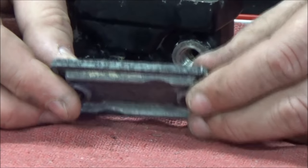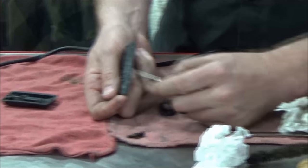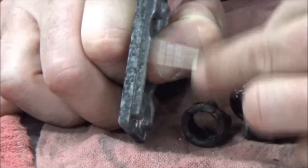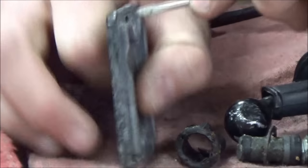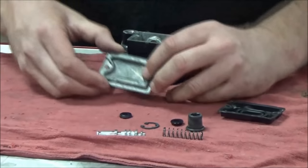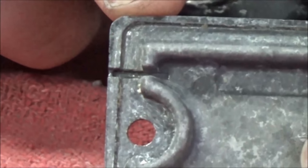I've got this pretty clean but I can still see some crud, so I'm going to show you the way I like to get that off. I'm going to move away from my clean area, take a screwdriver, and chunk that off. There's no need to put back together a rebuilt caliper with that corrosion. Now we're going to focus on this little guy right here - the atmospheric vent - and let me explain how that works.